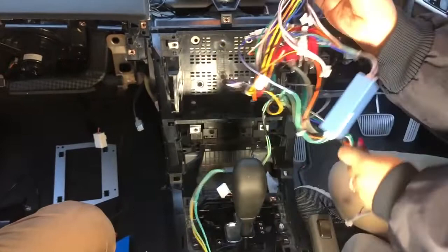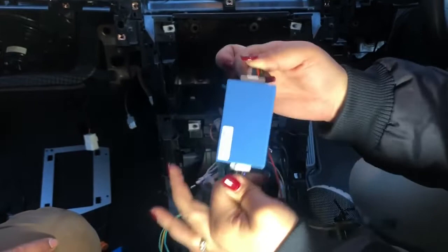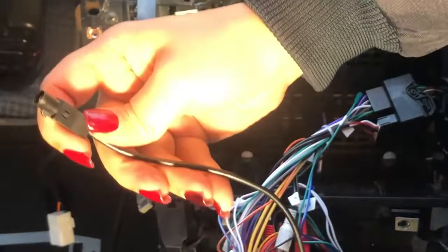With the VE Series 2 we need to do all the wiring first. Phase has already connected the canbus — connect both ends and make sure it's plugged in properly. If it doesn't sit properly, certain functions will not work. Now let's connect the power cable — it's a bit hard to get your hands around here. That's your power cable — plug it in, push it all the way in, and there's a little clip you push down to lock it. That's perfectly fine — if I pull it, it won't come off. Next is your radio antenna, just like we unplugged it on the other side, now we plug it back in.